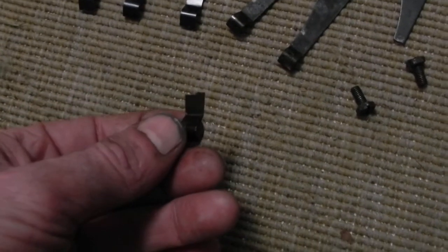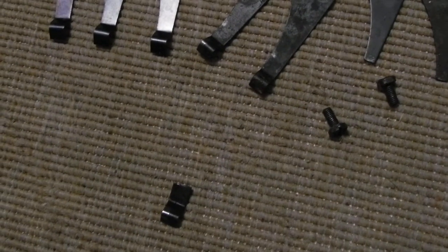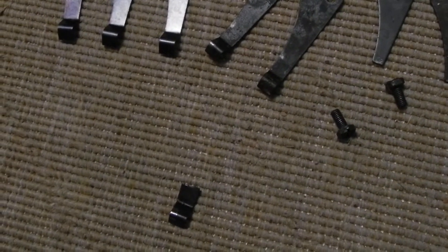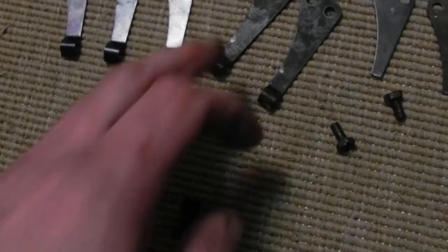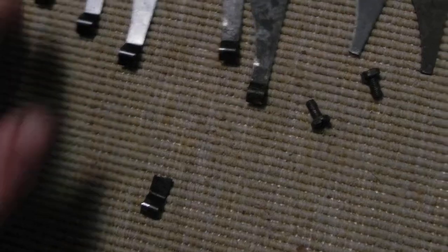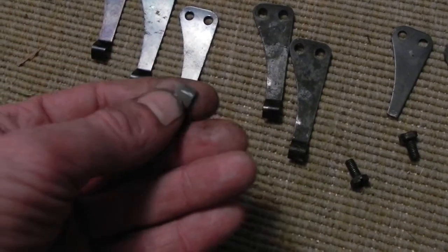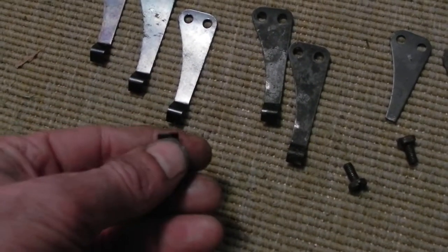There's not much that you can do to a box if it's been assembled properly that you could break it. I've revved my gearbox ridiculously and abused it, and broken detent springs are usually the only thing that I have go wrong with it, other than perhaps a nut coming off the main shaft or loosening or something.